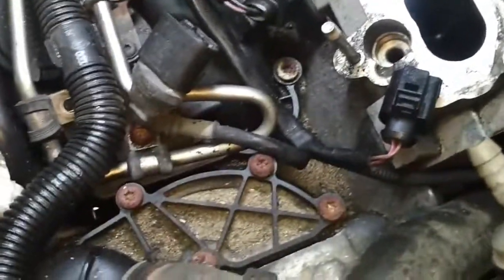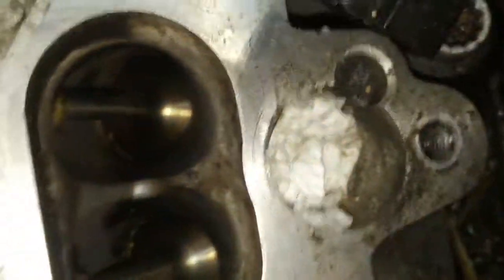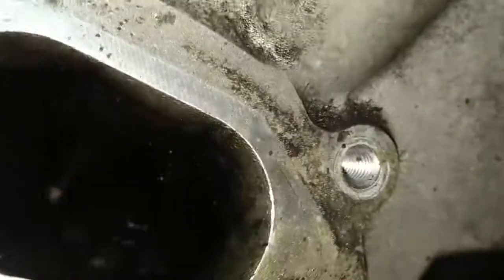The driver's or passenger-side bank is done and the valves look nice and clean now. This one looks pretty good. I just wanted to show the before and after — I can't really see it but it's pretty carboned up in there before blasting. I had run top engine cleaner through this but I don't think it helped much. So that's the before and you just saw the after.